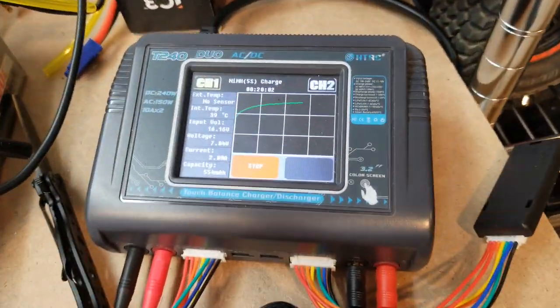Now the next thing to do is just obviously make sure that this battery is fully charged. We're going to mix up some fuel today, and we're going to start the break-in procedure. Yeah, and then after that, we'll probably have to loosen some screws and re-Loctite things from Hybrid. That's one of the things that's fairly important, making sure that you Loctite everything. I think even Steel City said the same thing. But it's kind of a known thing. Anytime you've got an engine vibration type of deal, you definitely want to make sure you Loctite everything. So we will go through this thing and Loctite stuff, but that's after the break-in procedure, because literally all I want to do is fire this thing up today.